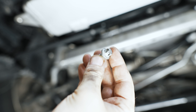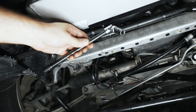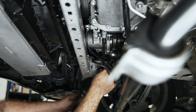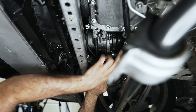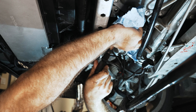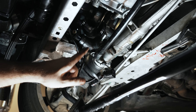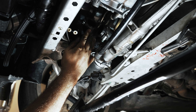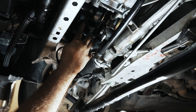It was just a swivel E12 on a long 3/8-inch extension. As long as you get that lower rad hose disconnected, you'll be able to get it in between. Now loosen these bolts for the water pump. Hopefully your clamps are positioned in a good way to get them out easily. Get the pump loose before you go after the inlet to the pump — it'll make your life a little bit easier, then you can get access to that clamp and take the hose off.